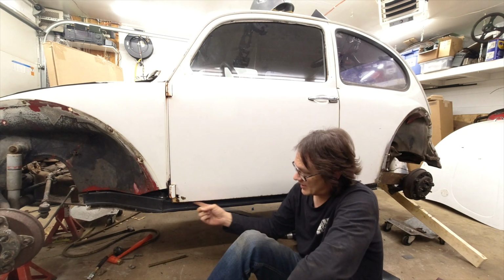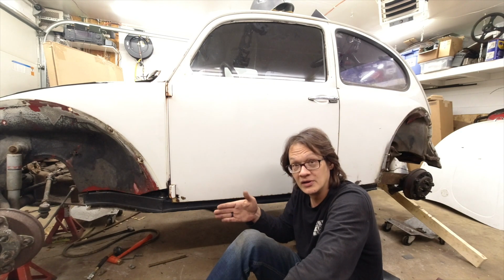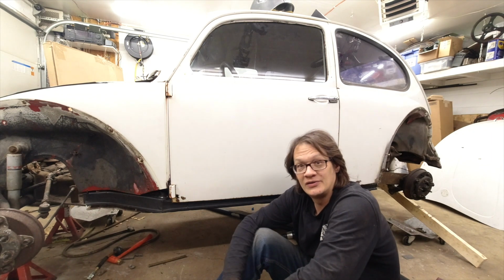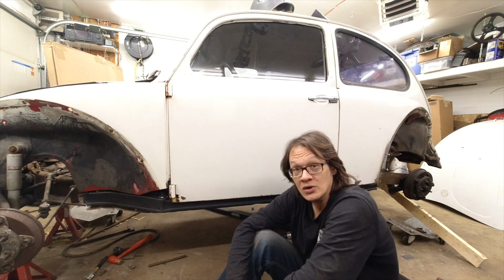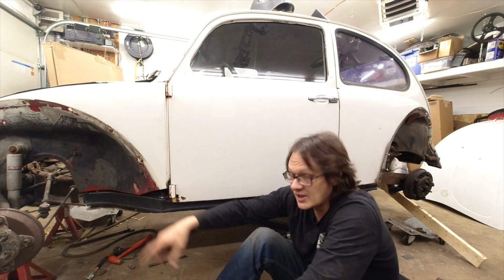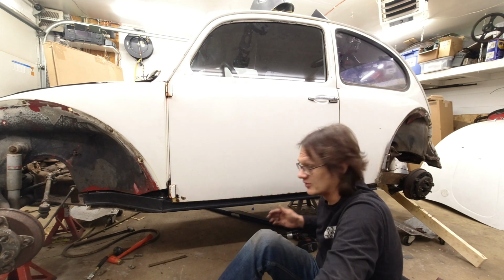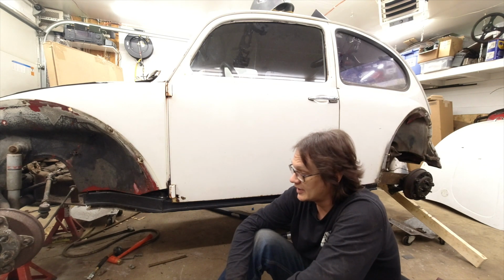But I do have the door gap along the bottom where the rubber seal goes correct. So that tells me that the heater channel is lined up left to right where it's supposed to be. I do have it aligned front to back because right back here where it starts to bend, I had to make sure that that lined up correctly. So basically the heater channel is sitting right where it needs to be. But when I pull it back out here, I'm going to show you the holes. The two bolt holes for the front are nowhere near lined up. So what I've done is I've scribed it to match the holes in the pan. And it's actually not the floor pan itself, but the actual frame head. So those holes are not going to move when we do our floor pan replacement. Everything's fitting real good right now, you know, with a few exceptions here and there. And that's really the only thing that's not working. So we're going to go ahead and modify that.